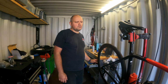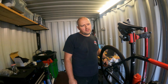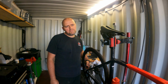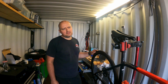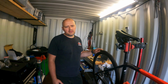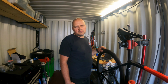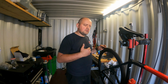And how often, in terms of servicing, would you recommend a full service once a year? Obviously it depends on how much people are riding the bike. Is it worth stripping it all down once a year just so you can be thorough? As you said, it depends on how many miles. I've got customers who do over 20,000 km a year, and I have to service every 3-4 months. They race every weekend. But other customers ride like 3,000 km a year. So if you do this sort of stuff, then once a year is not a bad idea. But then of course, keep up your bike maintenance, and if you can do it at home, no problem.